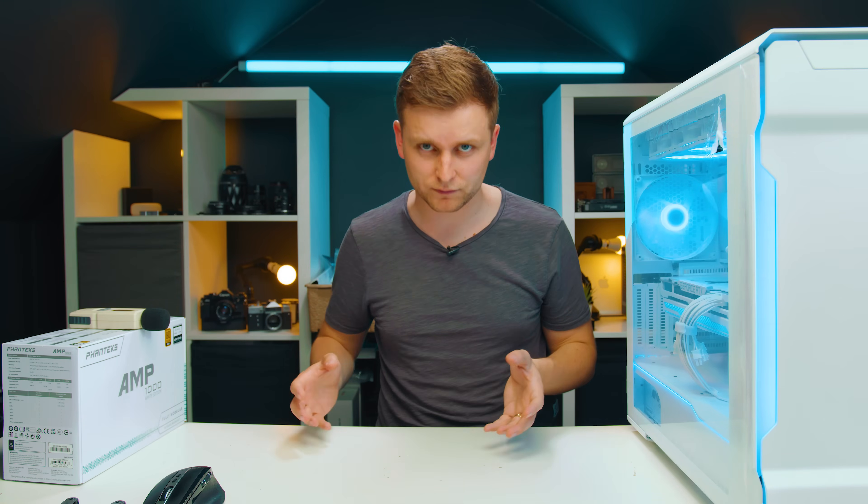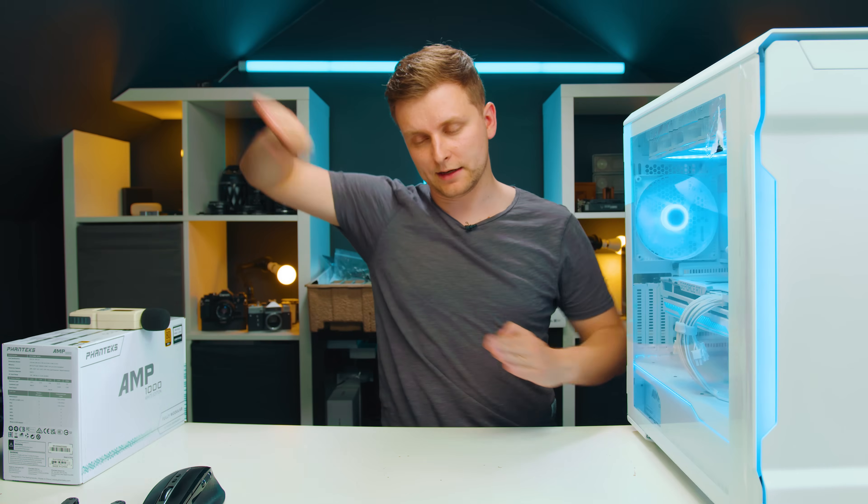When I'm this far from it, I can just barely hear it — the PC is not making noise most of the time. The most annoying thing as a creator or when editing is when your CPU temperatures spike momentarily and all your fans suddenly ramp up — that's when fan curves are literally linear and it happens. We want to keep the fans at maximum quiet speed as long as they can, then do a little curve at the end when they actually need to cool the system down. Most of the time your PC won't hit those high temperatures, and even when it does the fans will kick in if needed.